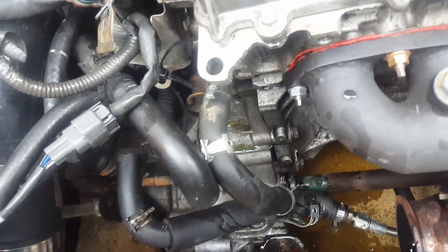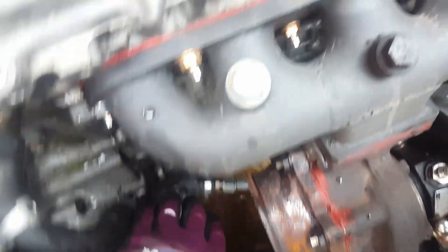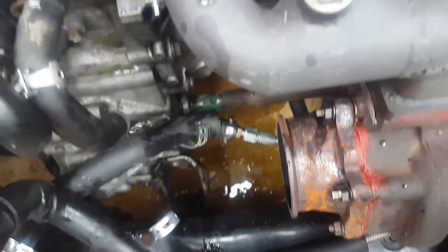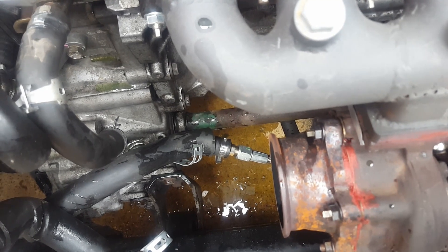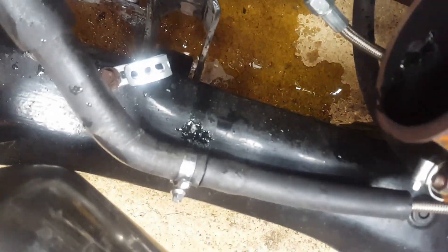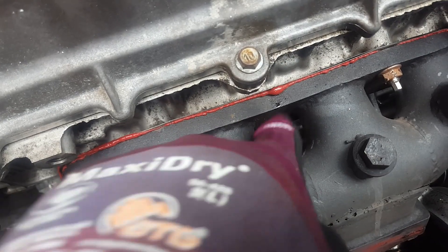I've undone that from there and put in a nice little bunged piece to keep the coolant in - not that it was pissing out anyway, but it's fine, and then this one here is bunged as well. The reason I decided to do it that way is because this braided hose here is probably like an 8mm and these hoses are more like 10, maybe 12mm. So what I had to do was sleeve that with some rubber hose and then jubilee clamp it down - it's pretty watertight so I don't want to disturb that, I'll just disconnect those.